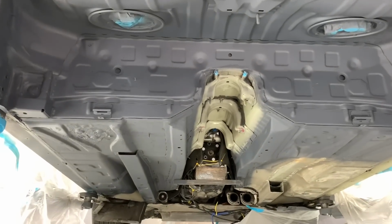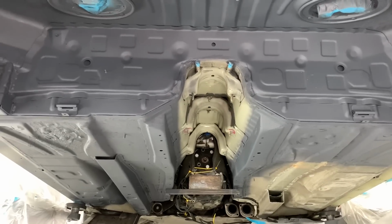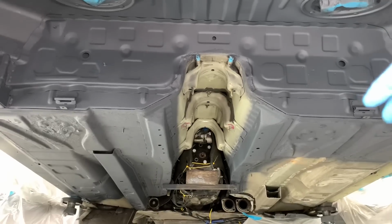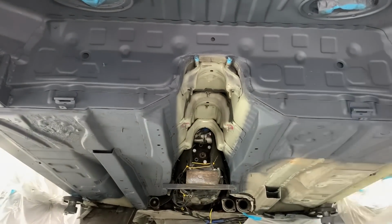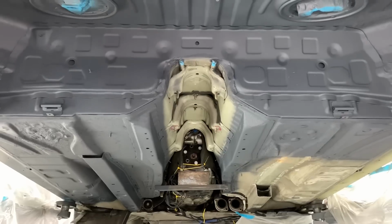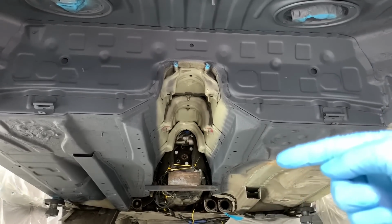If it's really pitted or really thin, then we'll go for a replacement chassis leg. Luckily you can still get them from BMW. We'll clean up the floor pan, take out the interior, remove the sound deadening, and then start the welding process to plug weld and connect the new chassis leg, and then do the weld line around that end, linish it back so it's nearly invisible, and then prepare it with weld through primer before it goes onto the contact points.